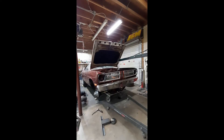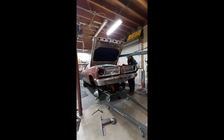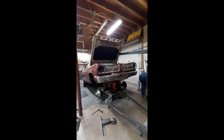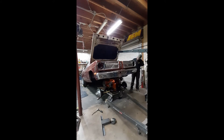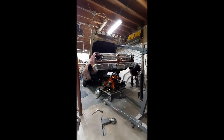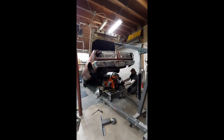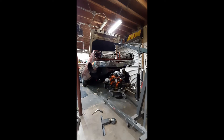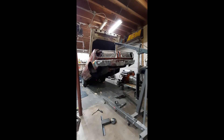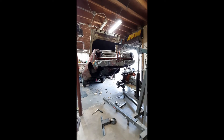I've got everything set up here to try to lift this body up off over the top of the motor. I've got a cart underneath the entire drivetrain under the K-member, the transmission mount, all of that, so that's all steady and blocked where it's supposed to be, the rear end's blocked. Mounted these chains up to the subframe up here and hooked them to the hoist, so hopefully the hoist can lift the body up high enough that we can slide this motor out the side and get everything out of the way.